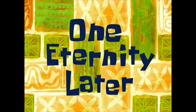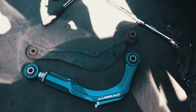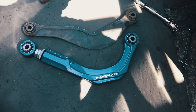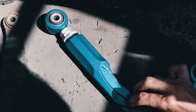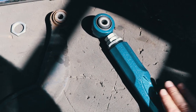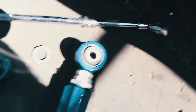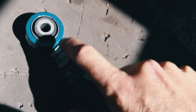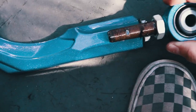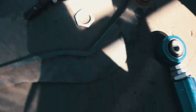One eternity later — right, well that took nine million years to get off. I've got no diagrams or anything but I'm presuming it lines up something like that. One of my mates on Instagram said I might need to do a bit of modification on these to get more camber, because they are set up at as much camber as they can go. You can actually take this lock ring off — it can screw all the way back and you gain another 5mm of camber, whatever that is in degrees.